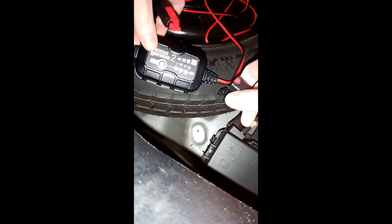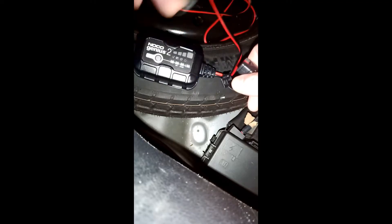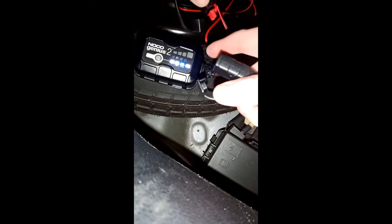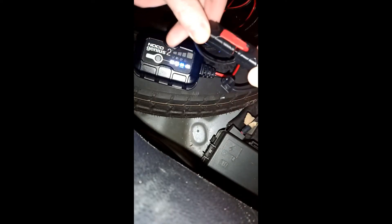It comes apart. You see that the charger is turned off — hold it down until you see everything light up. This is force mode, and what this will do is force the battery manually to start charging if it's below 1 volt. A lot of chargers do not have this capability. I've already brought back one battery to life with this in another vehicle.